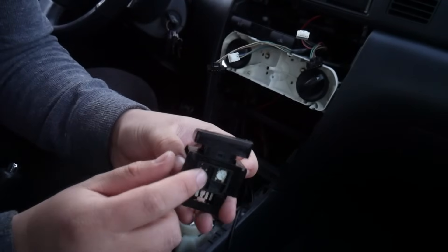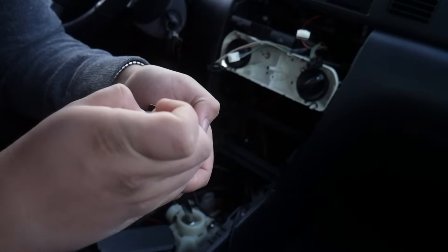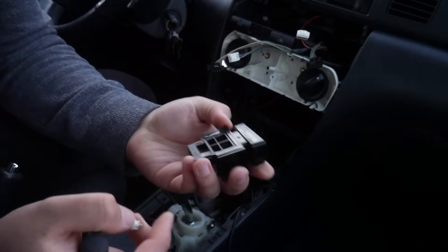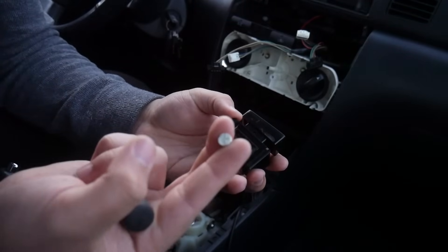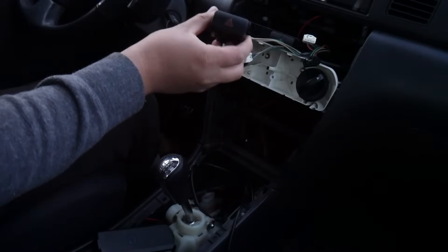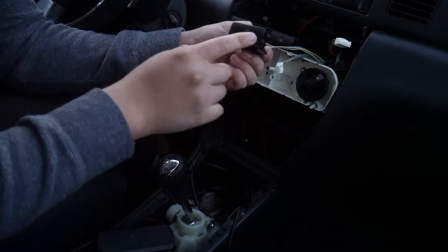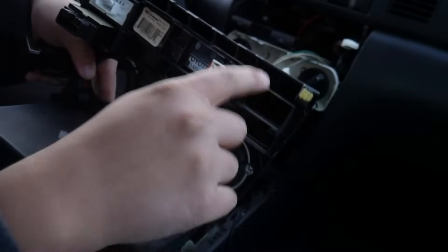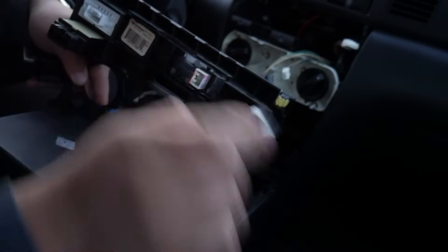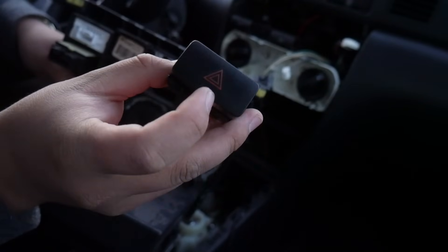Same thing for the emergency light on the bottom — the bulb is down here, just take it out. I got lucky because these are actually two different bulb sizes. For everything else I've used it's a T4, but the flasher button uses a T3 — which are actually the LED bulbs I originally bought but didn't end up using elsewhere. Test to see if it works — it does, but it's a lot dimmer than expected and very similar to stock despite being an LED. Honestly, I wouldn't even recommend replacing this one — there's really no noticeable difference.